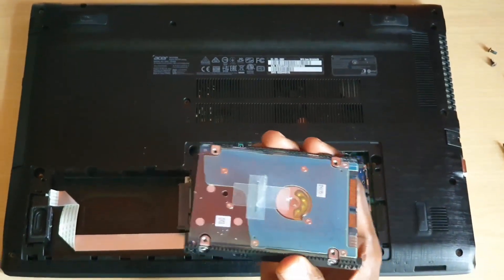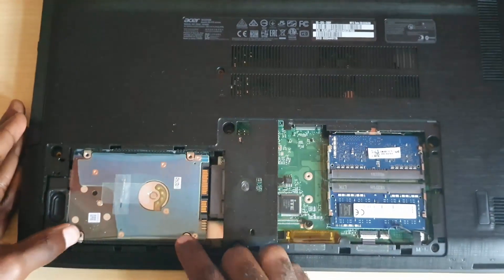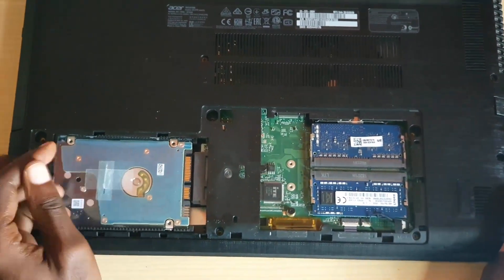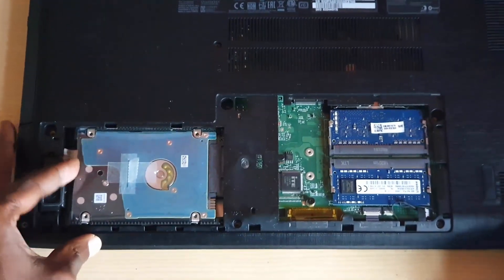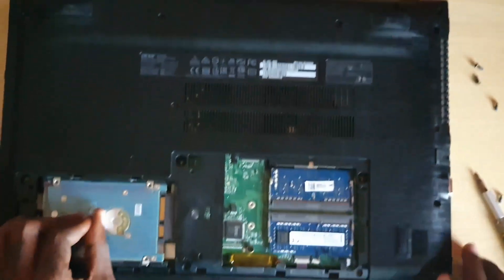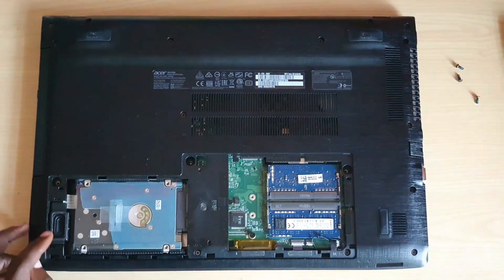To place the hard drive back in, find the groove — be careful, this is mechanical, so don't drop it. Go in from one side first and slide it down into its cradle. Make sure it's sitting flush, then slide it back into the upper section of the cradle, closing the gap. Once done, replace all screws including this particular screw here.